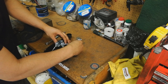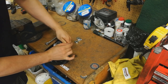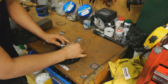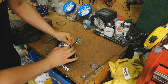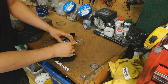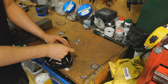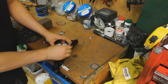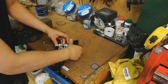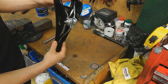We don't have the center pin in at the moment, but we do have the seat clamp installed. Just run the center piece through - you may have to fettle with this a little bit, may have to pull the side of the seat down to give a bit more clearance. Make sure everything's lined up and it will go through. Push that through the other side, pop your end caps on, pop a little bolt in to get started so that one doesn't fall off, pop the other side on, pop the bolts on and we're done.